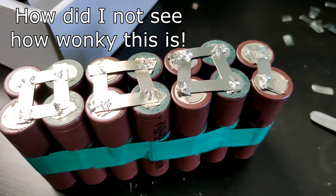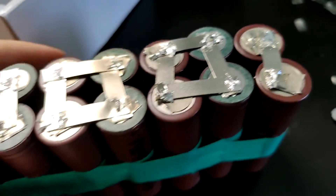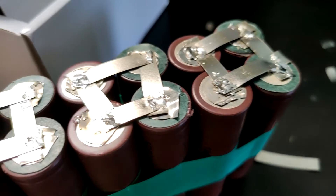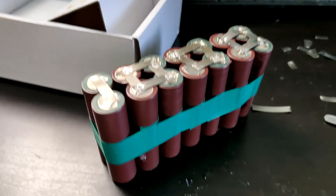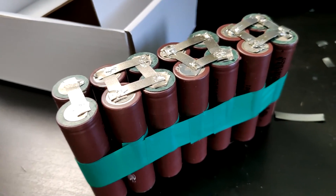Okay, so I have finished the soldering, and as you can see, it's pretty rough. So I'm going to go around and tidy all these up and improve it. The voltage is correct — we're getting 29.1 — so we're pretty good. Now I just need to take apart the old battery, put that BMS on this one, connect it, and test it and charge it.